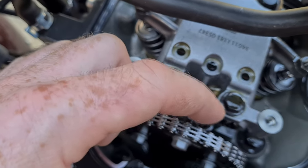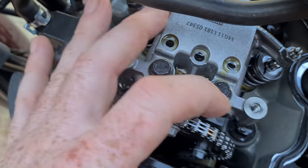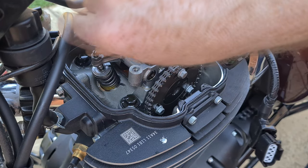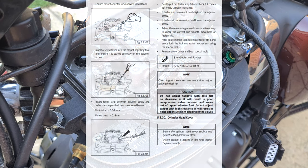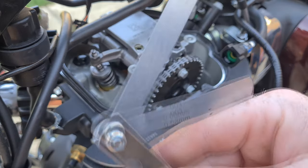The camshaft gear will have a T on the top — this should face flat with the rocker arm clamp. Check the valve rocker arms have free play. If they don't, turn another rotation and try again. Here are the valve gap measurements: 0.18mm for the exhaust and 0.08mm for the inlet.